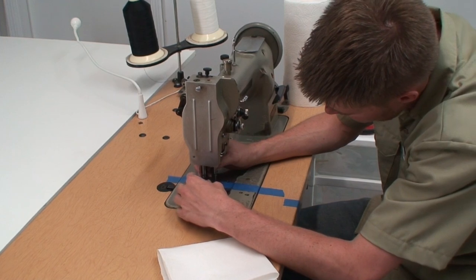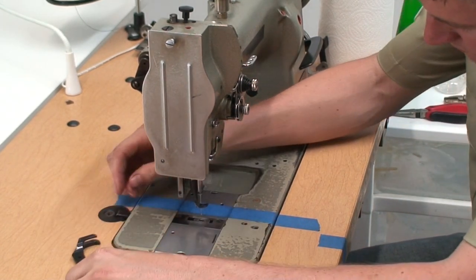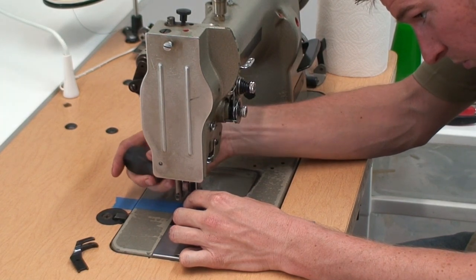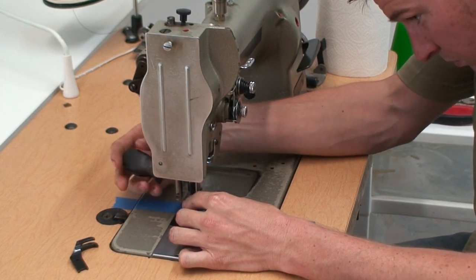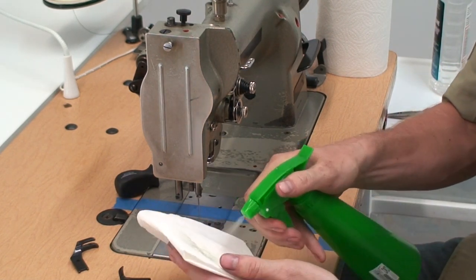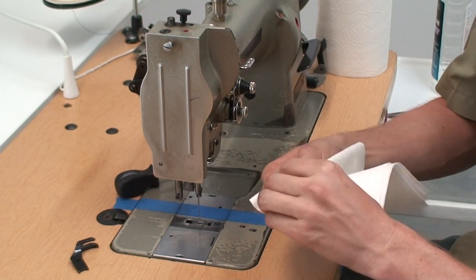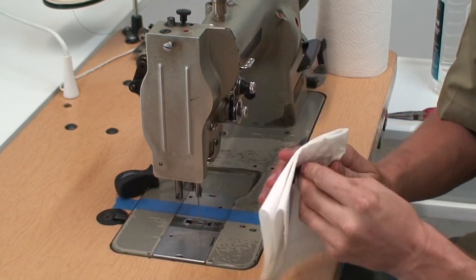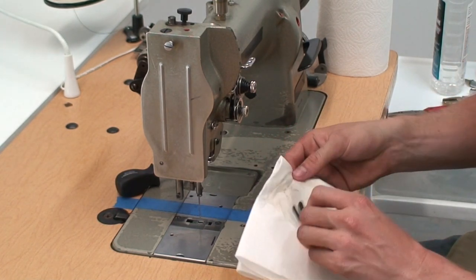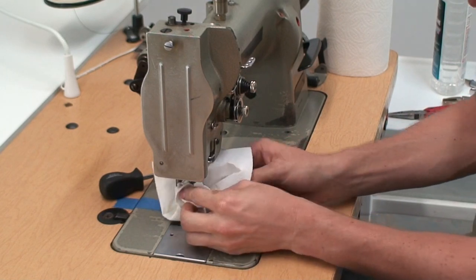The first thing we're going to want to do is remove the feet. Just get your screwdriver and take your feet off real quick. I always like to put the screw back in so I don't lose it. Then go ahead and wet your paper towel down with some Simple Green cleaner and clean these feet off real quick, because they tend to get all oily and grimy from sewing. It's good to clean all of this off every once in a while so it doesn't get your fabric dirty. Make sure to get up in the nooks and crannies.